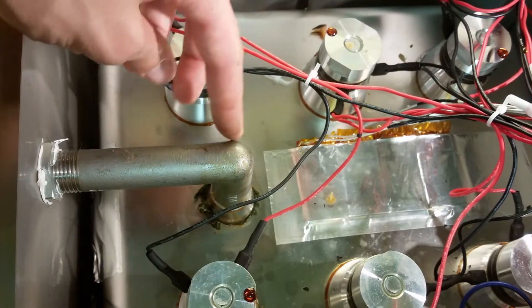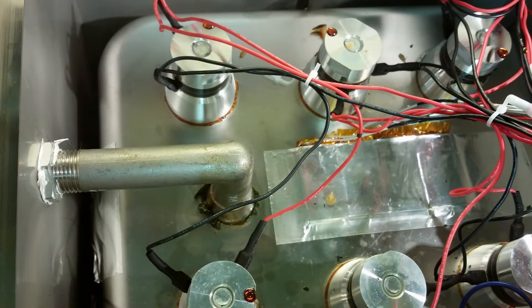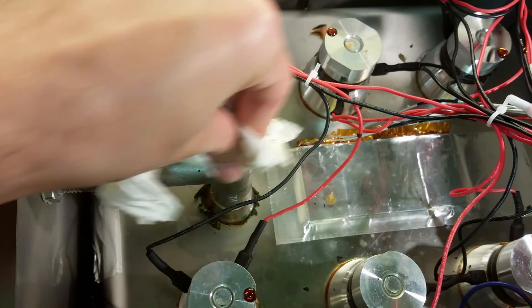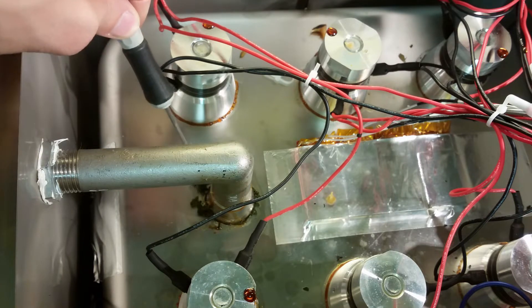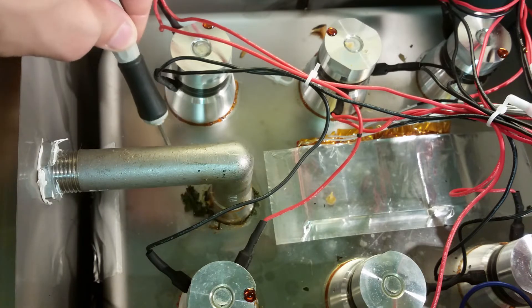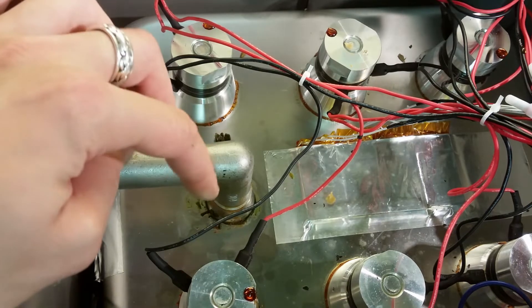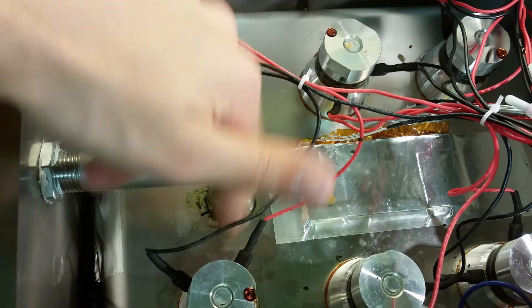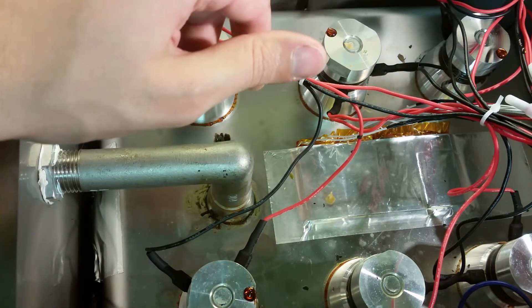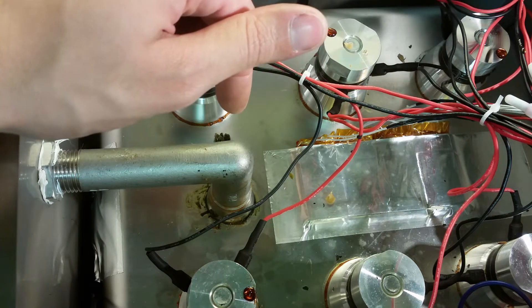That's the drain tube here and it looks like there's some residue on it. So maybe it's actually leaking and dripping straight onto the fan. This thing is leaking — I need to seal this somehow. Maybe I need to put some 2-component adhesive on this tube here on the bottom, so it seals better. I need to find an adhesive that is vibration resistant.